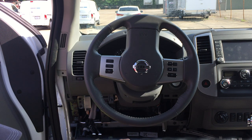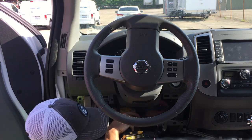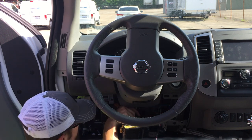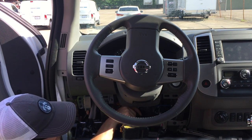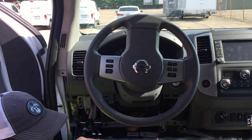You always want to ground any 12-volt accessory first before you connect all the other wires, otherwise you can blow fuses or whatnot. Especially because if you hook up the power and then the ignition, it might try to pull ground through the ignition wire, and that's never good. I'm just going to screw this to the brace right next to the ignition stuff — a self-tapping screw. It's nice and secure in there.